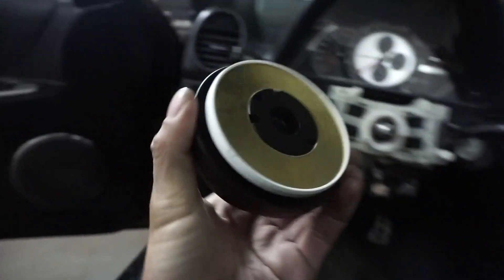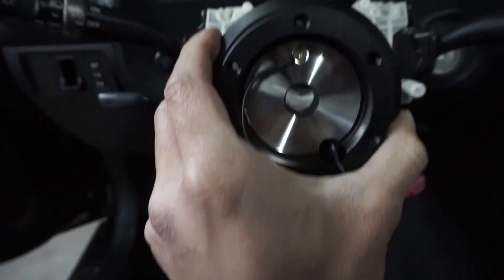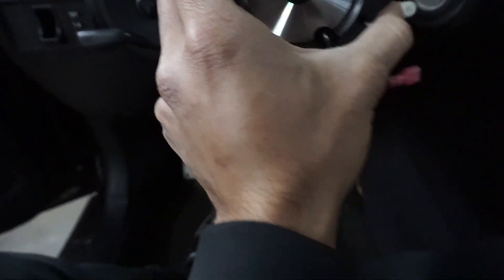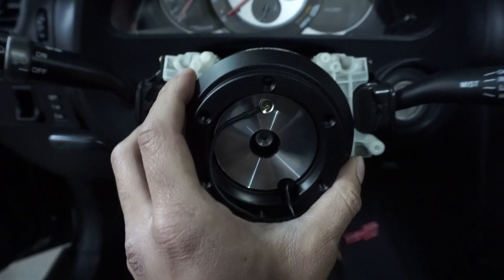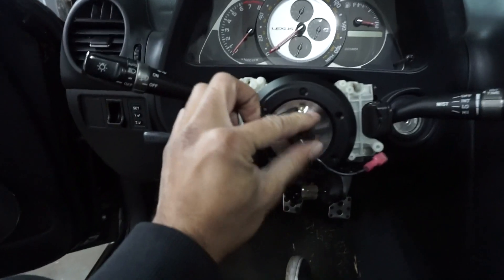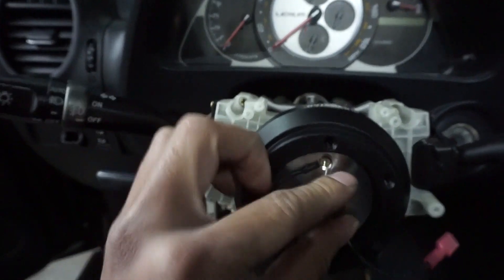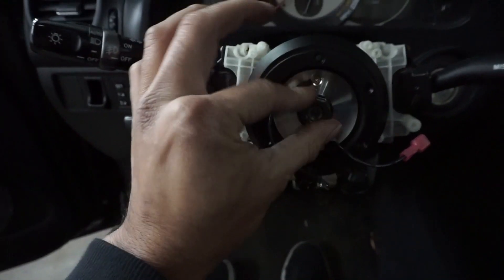I put a little bit of grease in here — try to get this as even as possible. Don't force it guys, this stuff just slides right in. The better the grease, the easier it slides. Alright, get the 19 millimeter nut on, and I'm thinking about putting the covers back on right now to see how it looks.